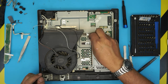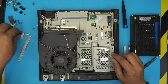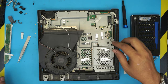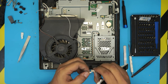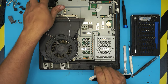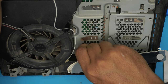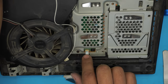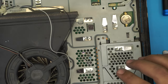There's a 0.4 mm thermal pad here you can replace if you want but it's not strictly necessary. Plug in this cable now as it will make life easier. Grab the power/eject switch and slide it evenly through the jack — push it in as evenly as you can; a few of the pins will show but push in as much as possible. Then grab your optical drive, assuming you've cleaned it.